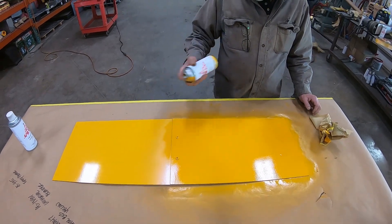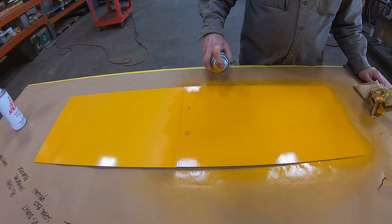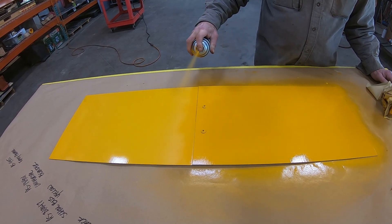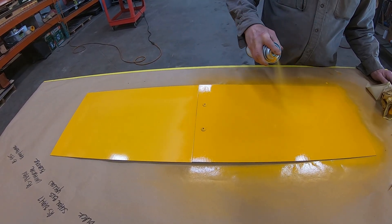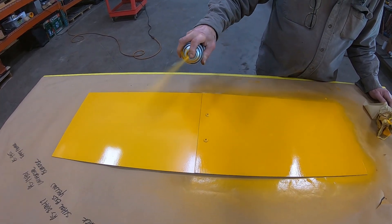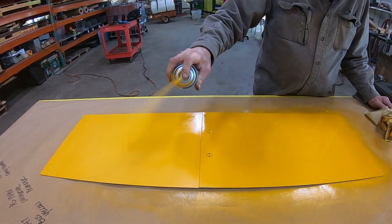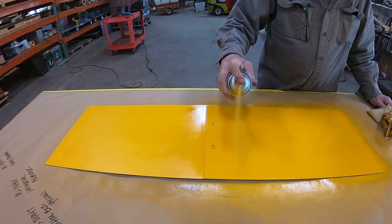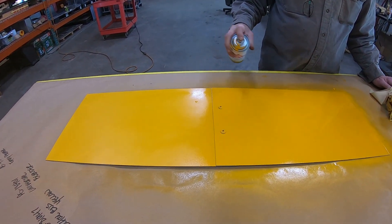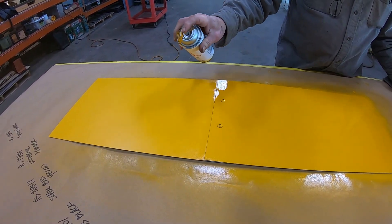What we're going to do is - probably don't take the paint can into that panel - just go from your painted panel and blow it out into your existing panel. You want to try to go a little heavier at the beginning of the next panel, just blow it out into the original bus panel.